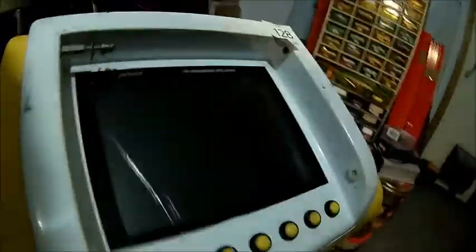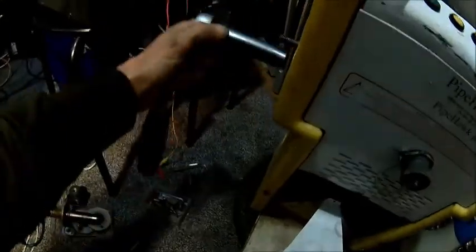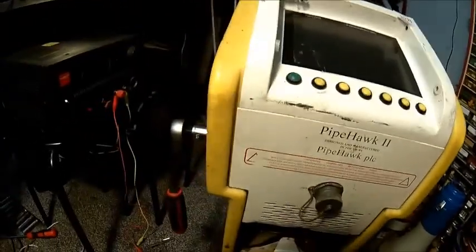I really think this is just Joe-public avoidance here. You need a long socket and get it out as far as you can. There is a 17mm nut inside. On the right hand side there is a nylock, on the left hand side there is a normal one. But it's very deep inside — you need to hold one side and move it on the other side to get it loose.